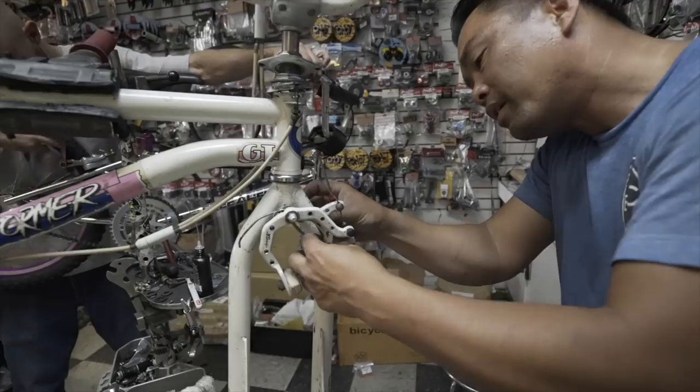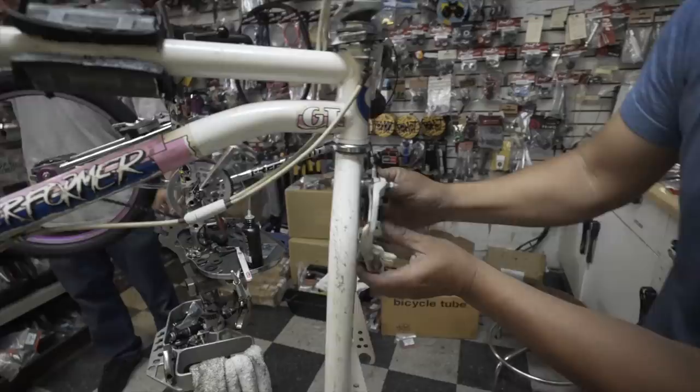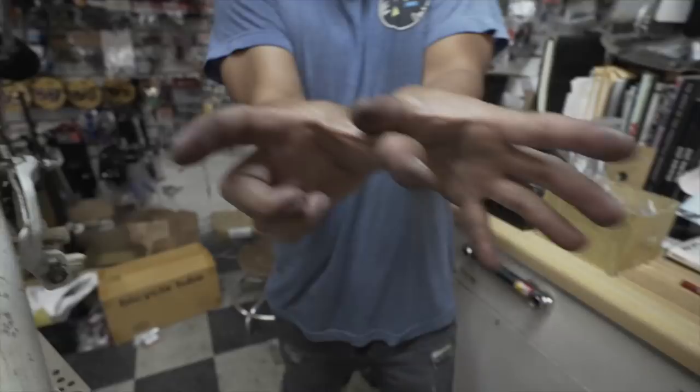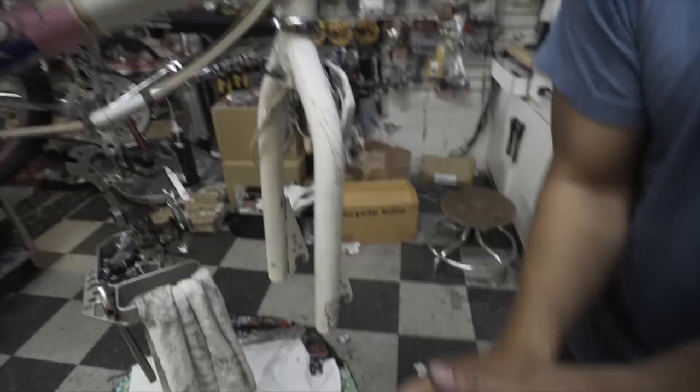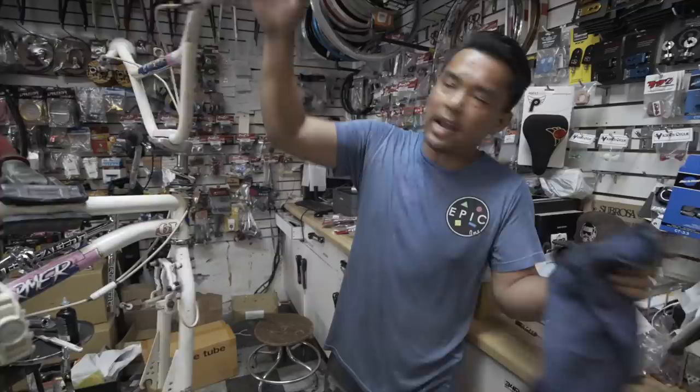Here's tip 2.5: you guys never notice how hard these brake levers are to pull? If you want to loosen the tension, there's a little spring — when you open it it's gonna pop out. All you have to do is bend these tabs in a little bit more — close it in slightly. See how it's softer now? So in case you've got arthritis or just can't squeeze that hard, take those out, bend them in, and it'll be softer to pull.